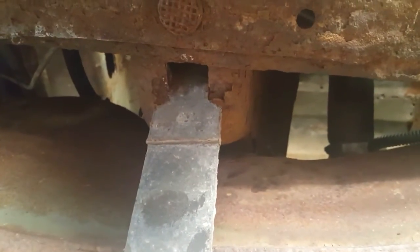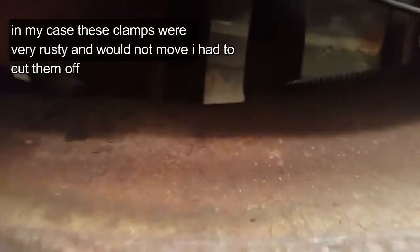Guys, once you get the skid plate down, if you could get to these bolts, these clamps, I mean, and loosen them. But I like to take them right off of the tank. So you're going to take, it's going to be 2 13s. I've already taken my straps off. Be one there, and one down there, and 2 13s. Then support the tank with your jack.